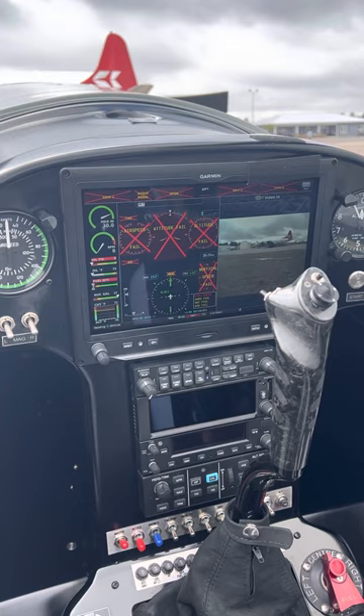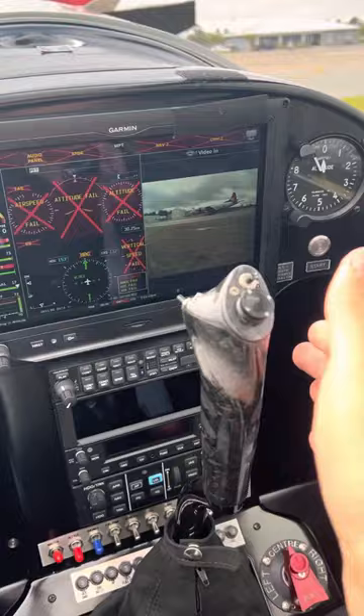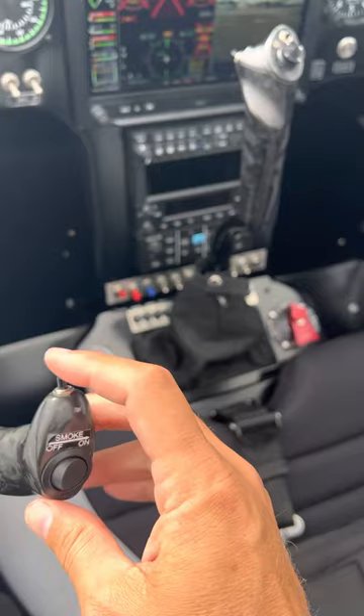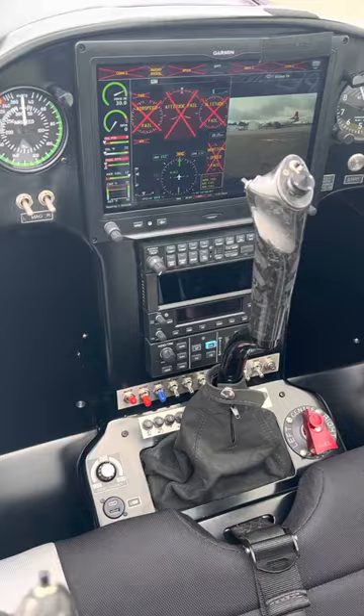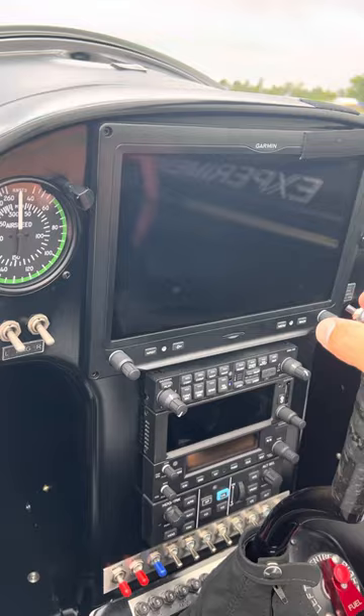With the IFR panel and all the gadgets in this aircraft, the all-up weight is 1,240 pounds, which is about 120 pounds lighter than my Extra. The aircraft has aileron trim as well as elevator trim, which is really nice — didn't think I'd need the aileron trim, but it's great to have. There's a flip-flop so I can switch comms with this button, and a smoke switch right here. I haven't flown any IFR with it yet, but we've tested the panel and it works really well. I wouldn't shoot a really low approach with this, but it would keep you from getting stuck on top.